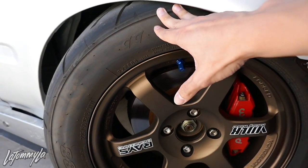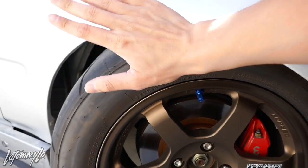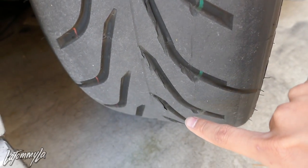What's going on guys, so today I'm going to be showing you guys how to notch your frame in order for you to go lower and run bigger tires, or just in general for a slam car if you really want to sit low. I never had to do it on this car because my car never got to the point where I would rub it or hit it, even at the track with aggressive turning. But ever since I got these new 225 50s, they're a lot bigger. I did raise up the car, but since I'm not running any spacers they sit more in now. You guys can see my tires get messed up, and that kind of sucks. The thing that's causing this is that frame up there.